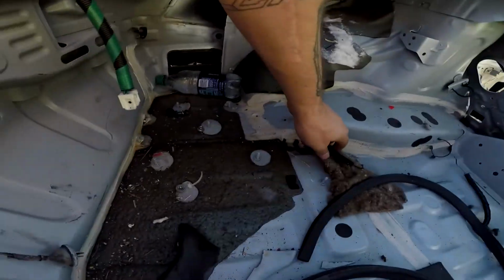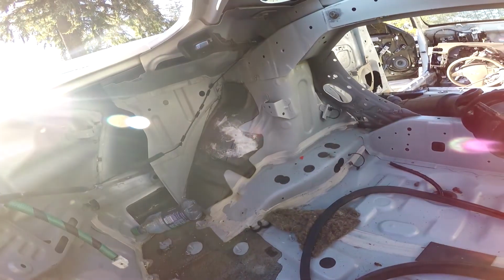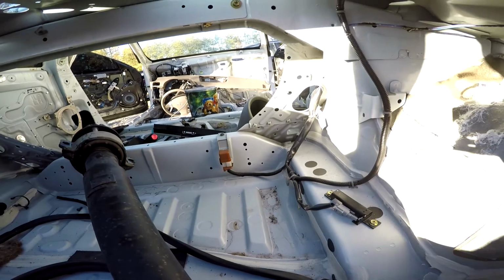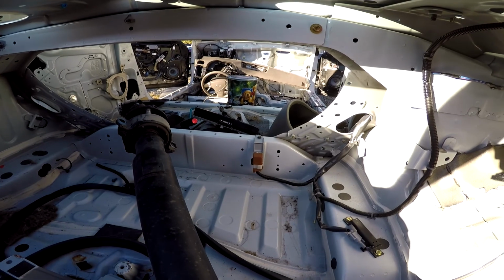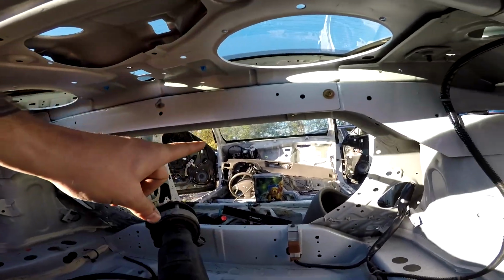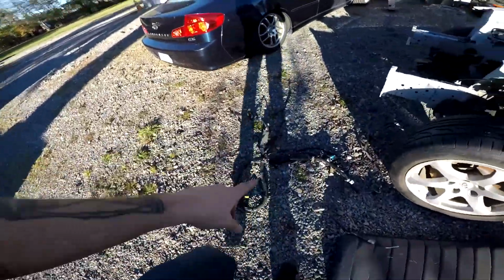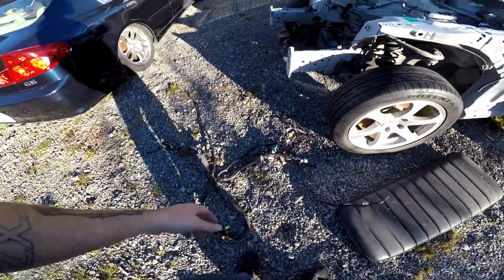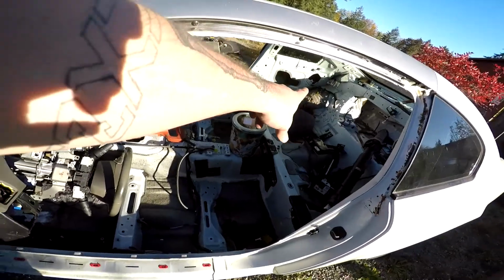I'm pretty sure this is just an antenna. Okay. I don't know what that goes to. Probably end up cutting that out. Getting rid of any alarm sensors, because everything's going to be ran off of a set number of relays. Everything's going to be controlled from the front cap. So far, we've gotten the trunk harness out, except for that one bit. Shit, I sliced myself open. I'm gonna go put gloves on. But so far, this is the trunk harness, and I'm gonna work on the passenger side trunk harness, because that goes somewhere.